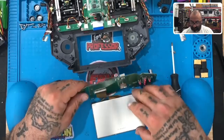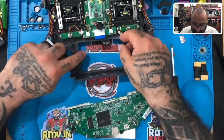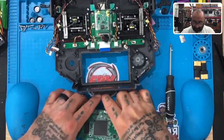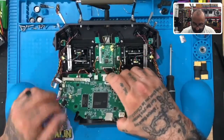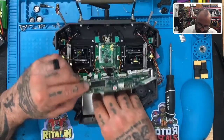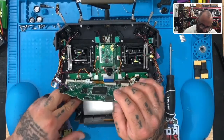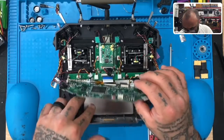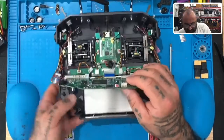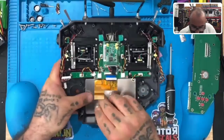Here's the new board with the screen already connected. We're going to lay the rubber frame piece into the radio first because it's much easier to do this while it's in the radio. Make sure it's in place properly, just like that. Then gently place the screen in — don't let too much separation from that ribbon cable because it can tear very easily. Press it in and work it around in the rubber frame.